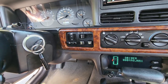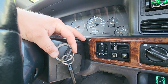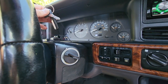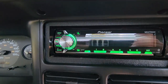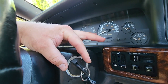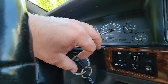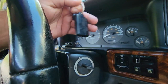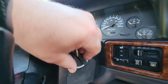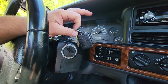Here's another thing I hate about this ZJ. Watch this: turn the vehicle off and take out the key — it's still on. It's not in the off position. The off position is in line with this nub; a lot of times you can over-rotate and take the key out while it's still in accessory mode. Something's wrong with this tumbler — it's probably not just a ZJ thing, it's probably a Chrysler tumbler issue. But this little key problem caused a whole lot of problems.